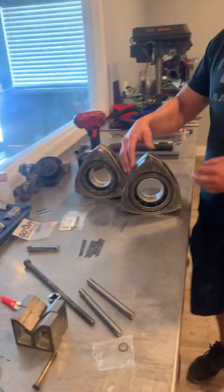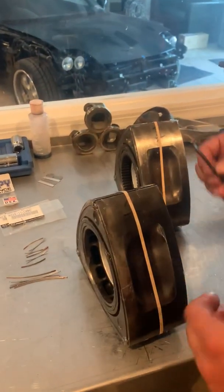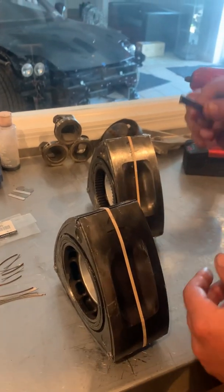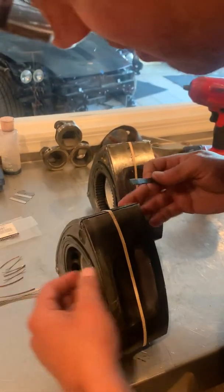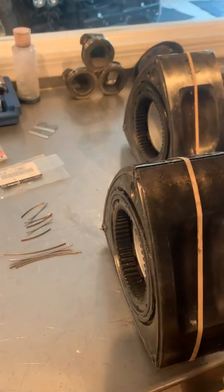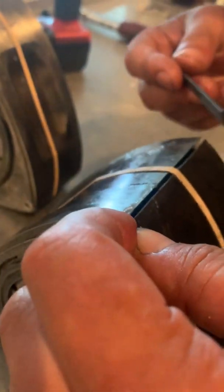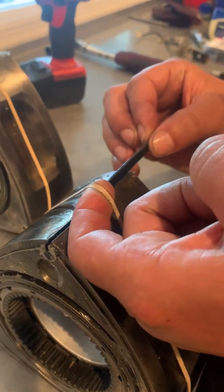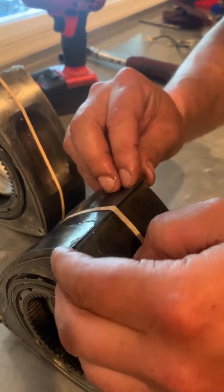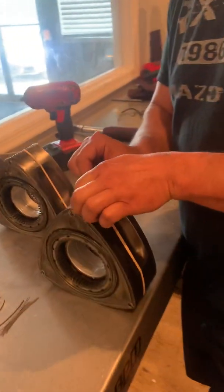So you just use a rubber band like so. Because if you put the rotor in and then you try to put the apex seal in — say you drop your rotor in and this seal here is just a little cocked like that — you can see it's just a little sideways and when you try to slide the apex seal in it won't go. So then you're trying to jam it in there, which is not the proper way of doing it. You can damage something and it's just not gonna work very well.